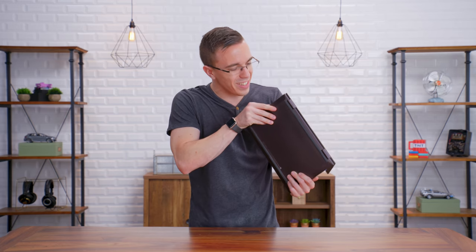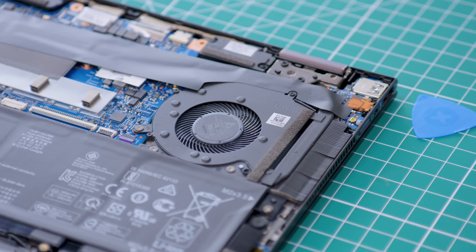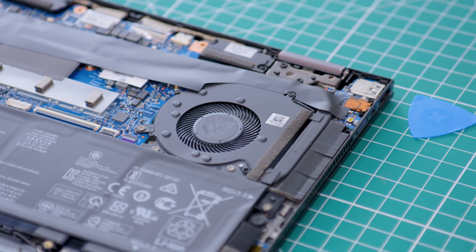For a quick burst it's going to be completely fine, but when it comes to long sustained loads such as gaming, the thermals of the chassis really hold back what that Ryzen chip is capable of. Opening up the internals, you find a very basic-looking cooler. That's made worse by the fact that HP is pretty conservative with the tuning — once it hits about 65 degrees on the GPU, the throttling kicks in. That's great if you want a nice, quiet, and cool laptop, but if you want to do anything more serious like gaming, you're going to be leaving some serious performance on the table.